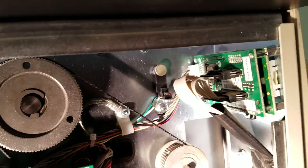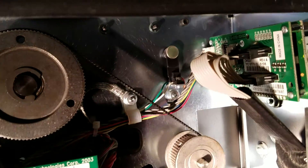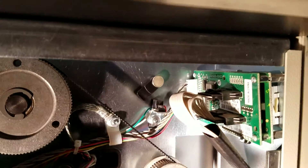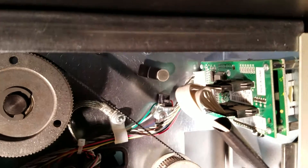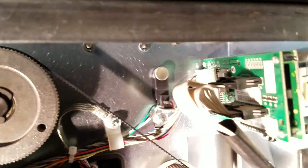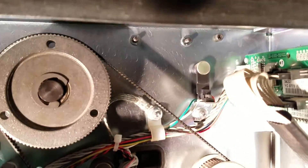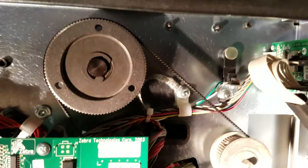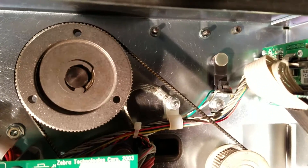now different generations of Zebras might have a slightly different way for that technology to be set up on the printer, but it's a very simple mechanism. When the head is open, you see this open now; when it's closed, the magnet or the sensor is satisfied by having that magnet put between the two hall effect sensors on the inside of the firewall.